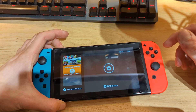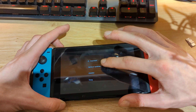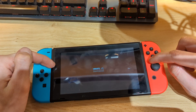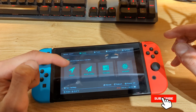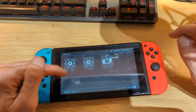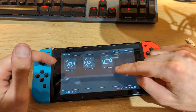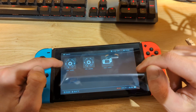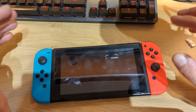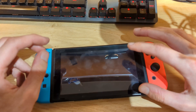So if you cannot boot to your official internal NAND partition, just go back to Hekate. Now we have to boot to the official firmware through Hekate as a custom firmware partition on our internal NAND. You will need to go to Launch and hit the option 'Custom Firmware SysMMC'. I've also tried 'Stock SysMMC' — that does not work. You need to hit 'Custom Firmware SysMMC' and this should boot our Switch to the official firmware, but with Atmosphere installed as well.